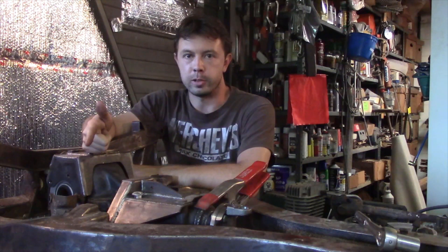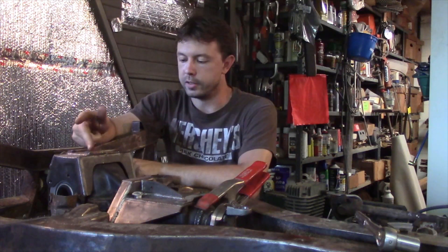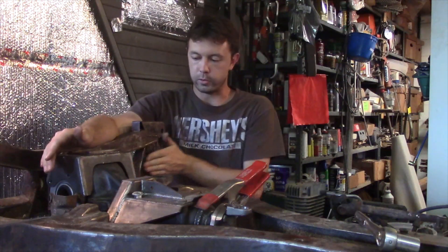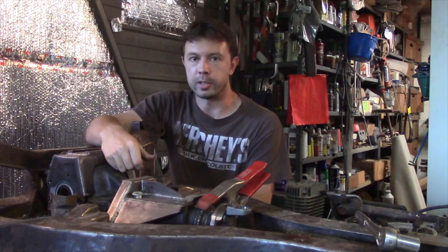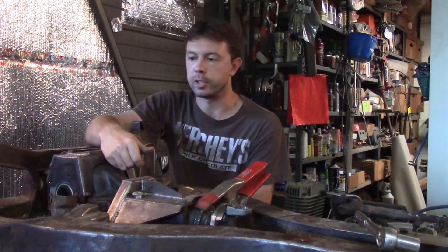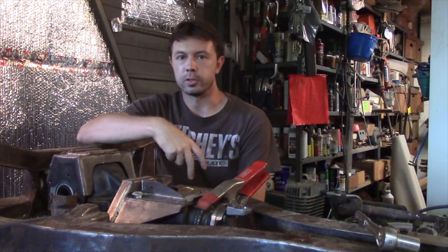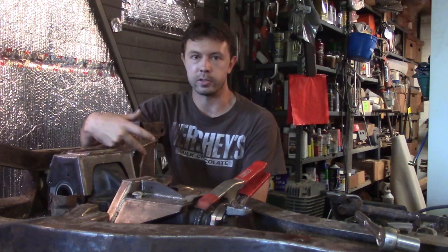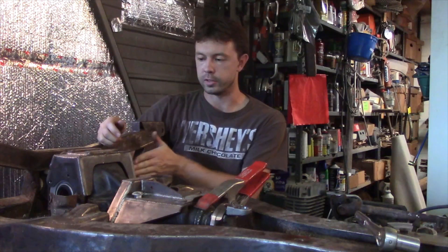Two, it's nice and small, rather light, which is good in a small and light car like this. And three, it is put together in such a way that it can handle thrust forces from the swing axle suspension, which isn't something a lot of rear wheel drive cars have to account for when they've normally got control arms. Instead, the axle itself acts as a lower control arm and transmits all those thrust forces into the differential.